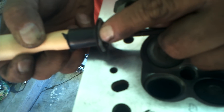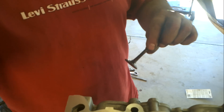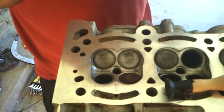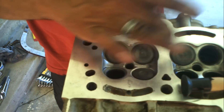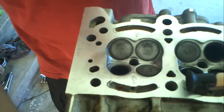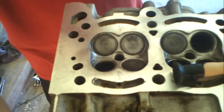It's a little line right there, so we're going to do it a third time because I don't like the sound of it. Now this is good. This side here is the one that's going to determine whether or not the valves are worth a damn. These are always going to be good nine times out of ten. These are going to be nine times out of ten being bad. Normally your exhaust valves are bad, or the seat is.